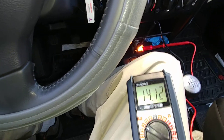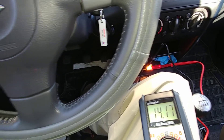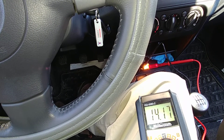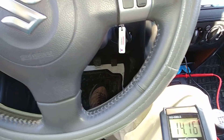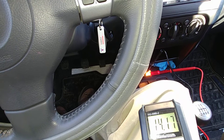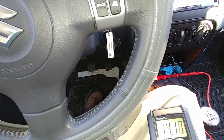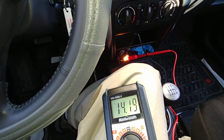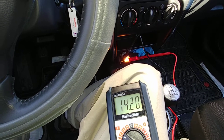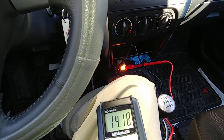I think what's happening is when you place a full load on the vehicle's electrical system, I'm not too sure if this is the ECU directing the generator, or is it the regulator that senses that the battery is being drained and it needs to charge the battery, and therefore the engine increases RPM. I don't know how the engine RPM increases — if someone has some insight in that, please do leave a comment below. Other than that, I think everything is working within spec here. Headlights on, fan on the second speed, and we're still maintaining around 650 RPM and above 14 volts.